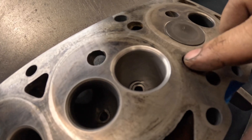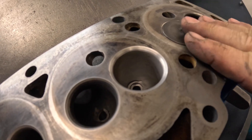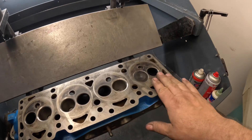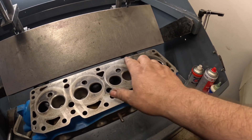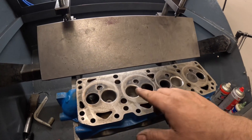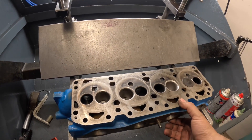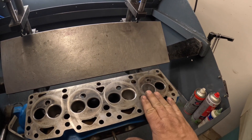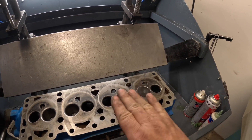Now I've got the three angles. I'm going to make the porting all the same, but first I've got to do the exhaust. So I'm going to set the seat cutter up for doing the exhaust seats, get them level, and then I've got all the data that I need to sort his porting out and make sure it's all nice and even. And then I'm going to give it a skim because what I want to do is bring the valve up into the combustion chamber a bit more.